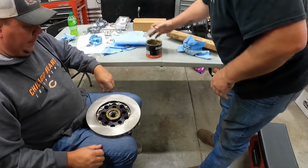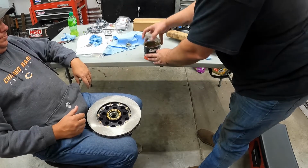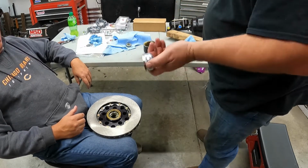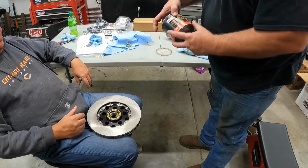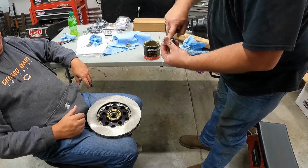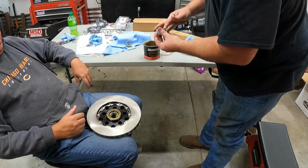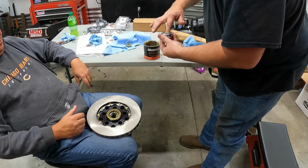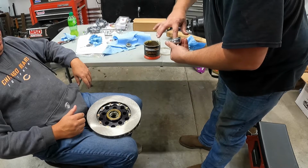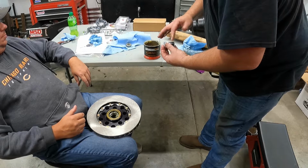All right. So we got to pack the bearings greased. Oh, yeah. And then your cap, a lot of people don't put anything in them. They just slide it over there. Again, too much grease is never enough, except for when it's just about right. So I like to slather this sucker up and just, I don't quite fill it up, but I get it, you know, probably half. That way once it heats up, this thing will never starve for grease.